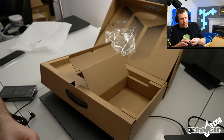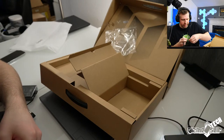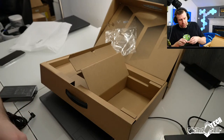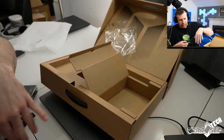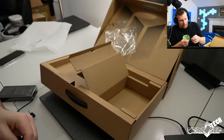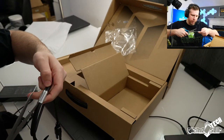A couple weeks beyond when I was planning to ship it to him because I needed to do the memory tests on the machine. And then because I held on to it for a little while, which he was okay with, I also offered to upgrade the RAM. So I upgraded the RAM for him to 32 gigs, taking the RAM out of my SCAR 15 and putting it into that Strix G15, or G17, I mean. So this thing is surprisingly difficult to open for some reason.